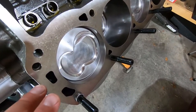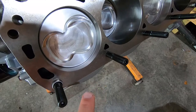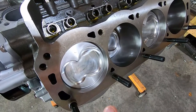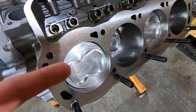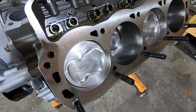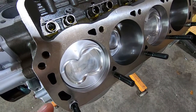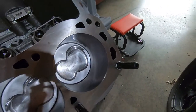Next step is to clean the cylinder decks. I have a painted surface at the edge, so I want to be careful not to use a solvent that's going to break down that paint — it hasn't fully cured yet with heat. When this thing fires up the Duplicolor with ceramic will cure fully. The best solvent I've used that is strong enough to break down oil yet not abrasive enough to remove paint is denatured alcohol. You can pick up a small blue can at Home Depot or Lowe's. Bank one deck is completely clean and ready for a gasket.